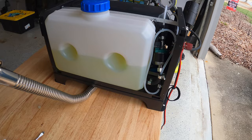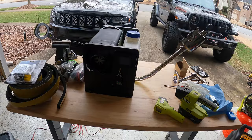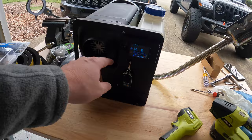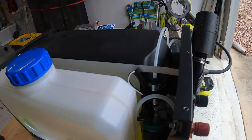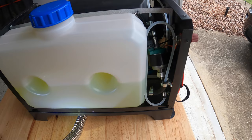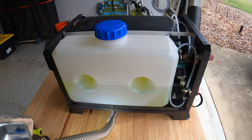All right, this thing is warmed up — we're on heating three, it's coming along. Got some heat coming out, it's nice actually. Got this thing fully warmed up — running at about 219 degrees coming out of there. We're at heating six, maxed out. And listen — there is a little ticking noise, but it is minimal. If I actually take these fuel lines and hold them together — I'm going to zip tie them together — it's even quieter. I was going to put insulation in here but there's just not a lot of space for it, and I think this has solved the problem.